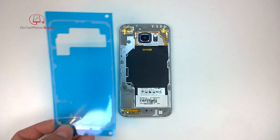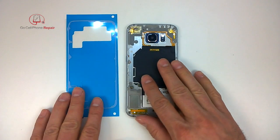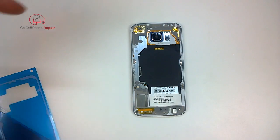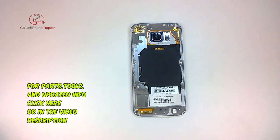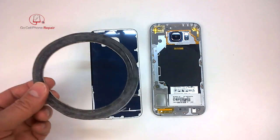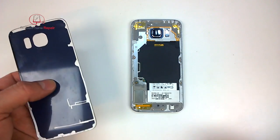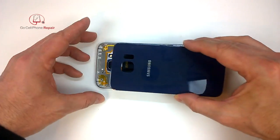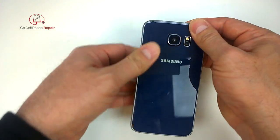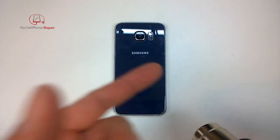So once again, the proper way to replace the adhesive is to either buy this pre-cut piece or get a new panel with the adhesive already installed. I will be taking this phone apart in the very near future, so I'm not going to worry about perfection. By the way, you can find all the parts and tools used in this video down in the video description. Also, do remember to subscribe. This piece that I had removed had an area that was not very sticky, so I cut that off and replaced it with some black adhesive. This is temporary because I will be taking this phone apart again soon, but you definitely don't want to put this on and then find out you have a problem. After you've fully tested the phone, peel off the wax backing of the adhesive — the rest is relatively easy. Set this down in place, and if you apply some heat, that does allow it to set better. Once you get the rear panel installed, go ahead and hit it with the heat gun, hair dryer, or set it out in the sun if you don't have other options — that will help seal everything up on the inside.